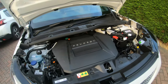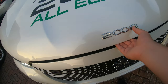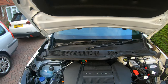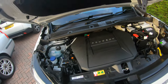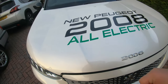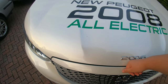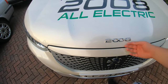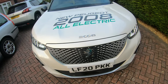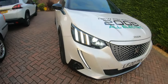I think it's about time we get to the interior, but first I'll show you a trick when closing the bonnet. You release the stay and the bonnet doesn't have any shock absorbers at all, so it just drops. A lot of people let the bonnet slam. The trick is: you push in with your fist, cushioning it until it clicks. That causes less damage. That's the way you do it.